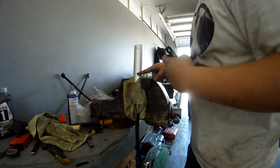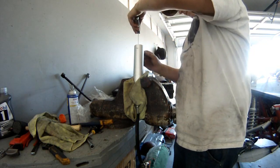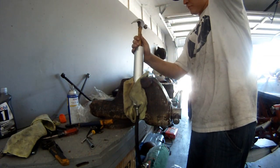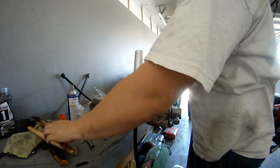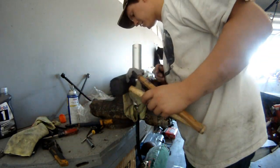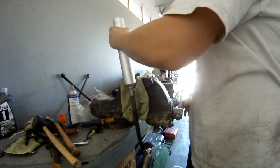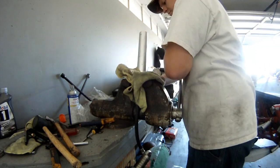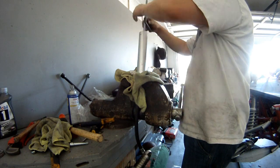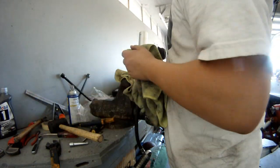The reason we do this is we have to measure where the internal floating piston is. Right now it's at about five and three-quarters inches and it needs to be eight inches. I'm going to get it down using a handle. A lot of times this will drive air and oil out of the reservoir into the shock body, so have something to catch the drip. Now we're at just under nine inches, which is over eight, so we'll just need a little bit less oil when filling the shock.